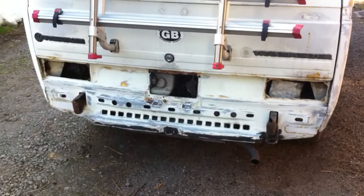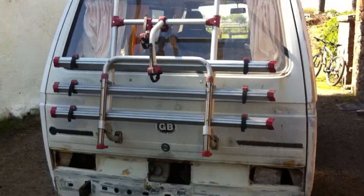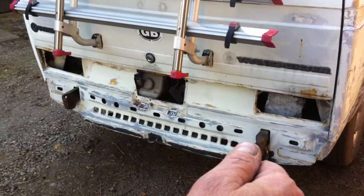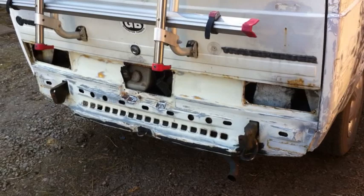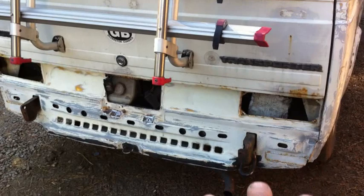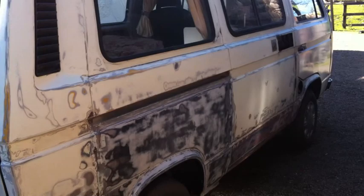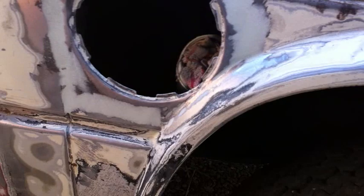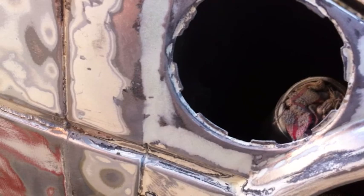All the sanding is done for what I'm going to be painting now - not the tailgate. At the back there, most of this area is hidden behind the mudguard. It has this kind of speckled, sprayed finish - like a stone chip that's been painted over white, I think from the factory. So that's just been keyed basically, as it's quite sound. I've ground down and filled the filler repair nicely and sanded it now, and that's come out very nicely.